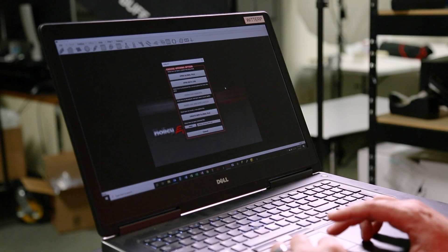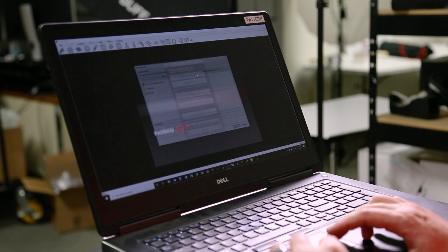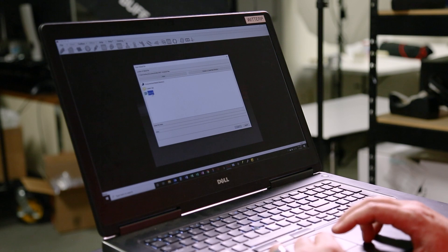Hi, I'm Ryan with Holley EFI, and I'm here to tell you about the new Holley EFI version 6 build 200 release. The firmware update has been improved to now take about three minutes or less when using USB. Previously, this was almost a half-hour affair on some ECUs, so we took the effort and listened to everyone and made sure to speed that up.